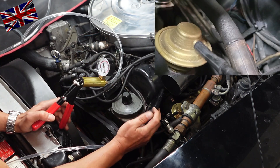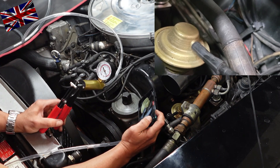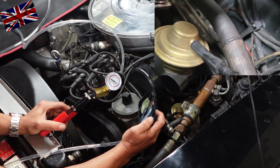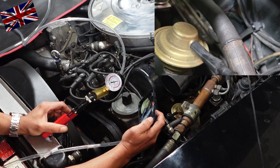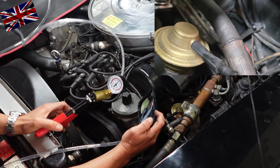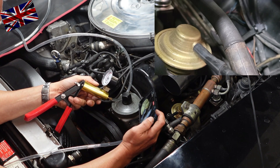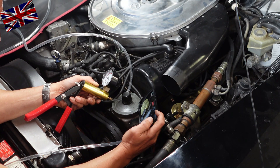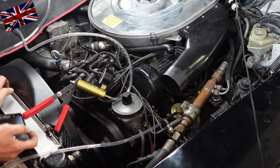I start pumping now. Have you all heard that click? If I now release the vacuum, it is fading and it will click again. Have you heard it? No clicking? Then this component must be unbolted, dismantled, and cleaned.